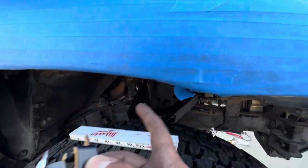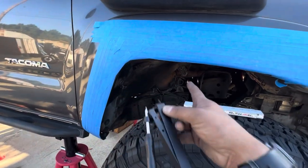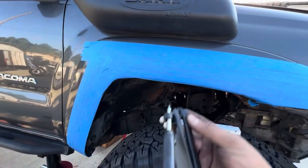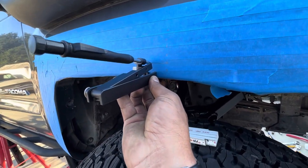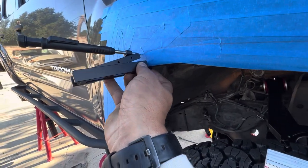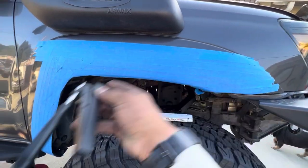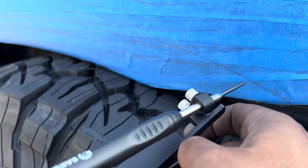I made half-inch mark increments — I want to keep this body line if I can. If I do end up trimming the whole thing and not just scalloping what's touching, I want to keep that so it stays true to the whole fender so it still looks right, just tighter. I'm coming across, coming around, and making my way down. I'm gonna do a few of those and then scallop it and see where it ends up. I went a little more than an inch and a half — went about two inches — and just rode the tire and made that mark.